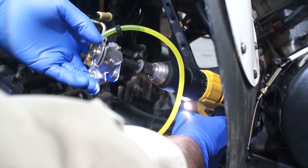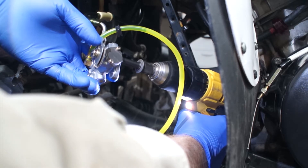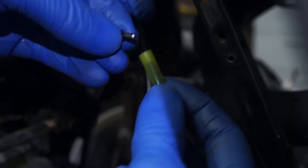Close it and start cranking the pump. If you had your pump completely clean, it will take 5-10 seconds before anything starts to come through. Run the pump until the entire line is full with oil, and then plug it with something smooth, like a screw that's not threaded all the way.